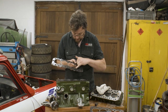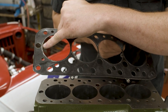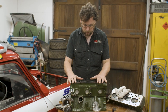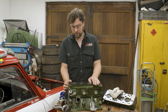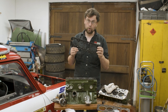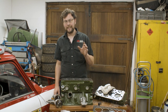The surface finish has to be incredibly high or else you get leakage across that surface area. You can clearly see on this gasket where it wasn't sitting properly — these shiny areas show that when the gasket was sitting in the engine and it was running, it was not sealing properly. The top side doesn't show those marks at all, and I know the cylinder head on this engine had the proper surface finish — the block didn't, but the head did. So: are these multi-layer stainless steel gaskets good? They are phenomenally good if you have the right surface finish on your cylinder head and block.